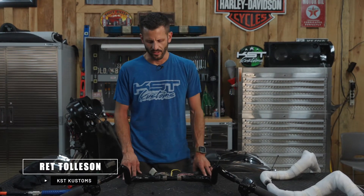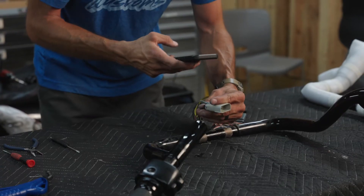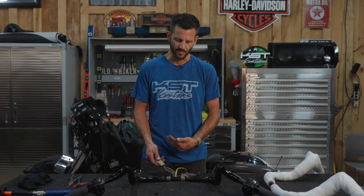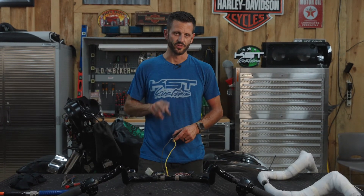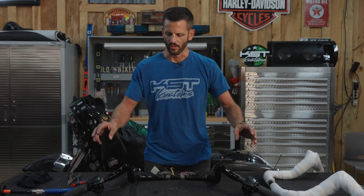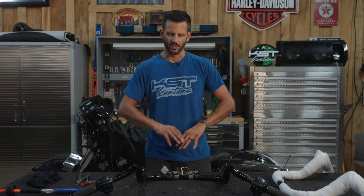We're ready for our internal wiring process. This is a little in-depth and you've got a lot of de-pinning to do. I highly recommend taking pictures of the wire locations or drawing a map — just make sure you know which way the plug is oriented, otherwise you can re-pin the wires backwards. On the throttle-by-wire you're going to have six wires: two red, two black, and two white, in a yellow sleeve and a black sleeve, so make sure that's oriented correctly.